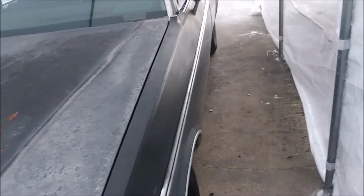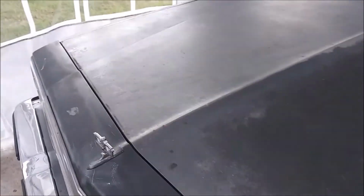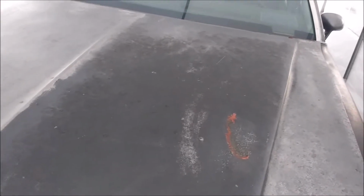If I do find a 350, I would like to find the Vortec 350, which would require me to wire in an electric fuel pump. But it has the better head design. It's the roller block. I just got to change the intake, put in bigger camshafts, and drill the heads for screw-in rocker studs. That's one of the weird things that GM did back in the day. Instead of using screw-in rocker studs like my truck uses, they're pressed in. And with higher RPM, bigger camshafts, and stronger valve springs, they tend to pop out. So that is the thing.